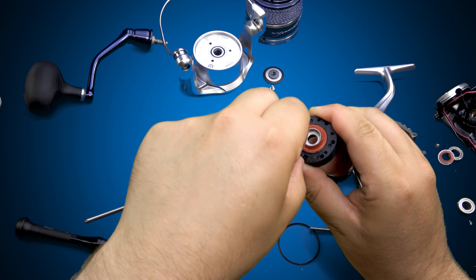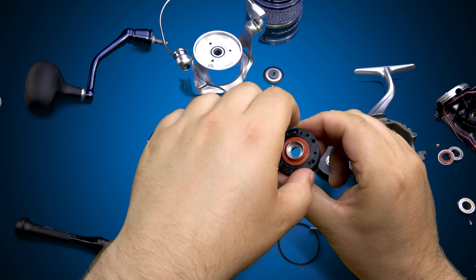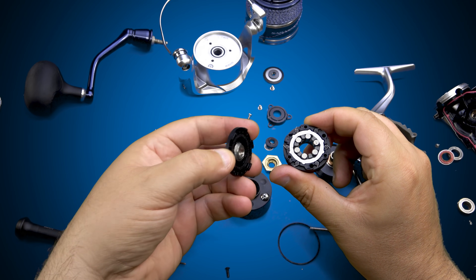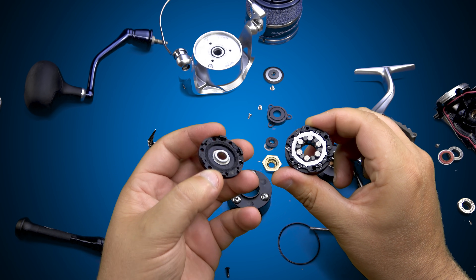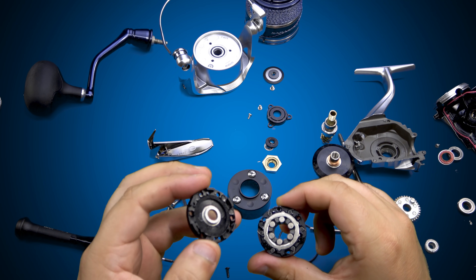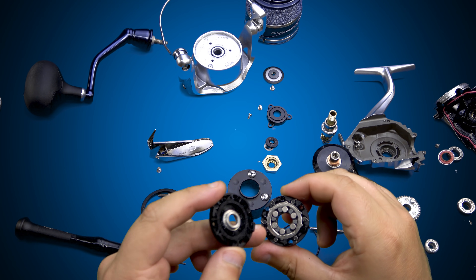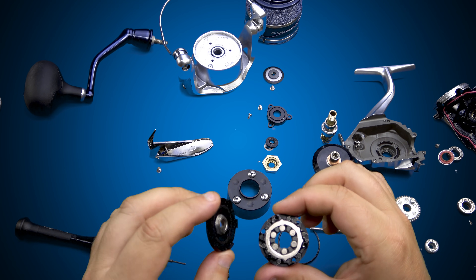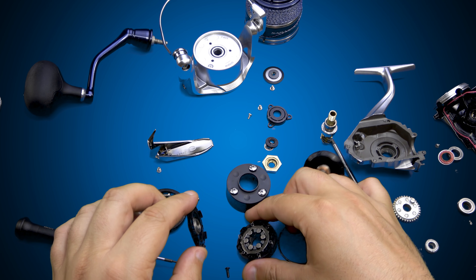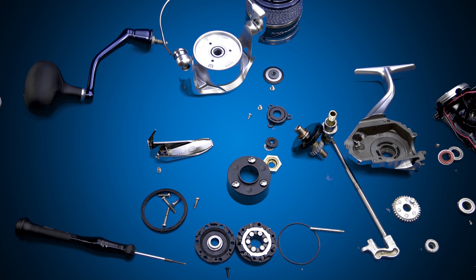This little screw here only exists so that when you pull the clutch off, everything stays in place — that way you can take it out. It's modular. You never really have to open this up unless something gets in there and you need to do really fine detail cleaning. Big cylinders, nice clutch — best clutch in the business. Very sensitive to contaminations, grease, and oil, so you want to make certain that if you go in there, you know what you're doing. Otherwise you're going to have failures, especially in cold weather.